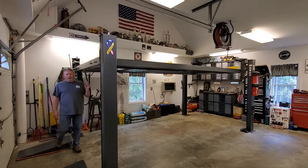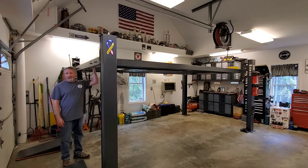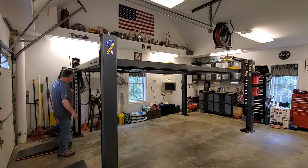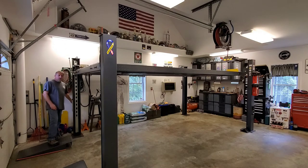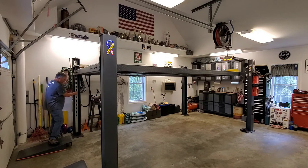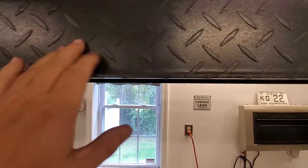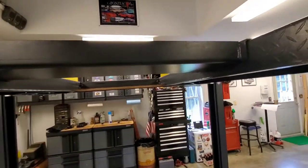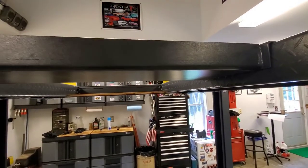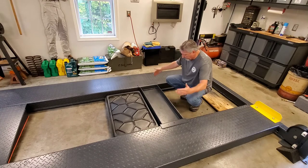So that's it all the way up, but it's on the cables, and that's not ideal. I don't want to leave it hanging off the cables, so once I get it up past that last notch on the rail, I lower it so the pressure is on the dogs now, not on the cable system. This is the jacking tray — you can put a jack on top of it and use it to lift the car off its wheels once it's on here. It's just a chunk of steel that rides on the edge of each one of the ramps.